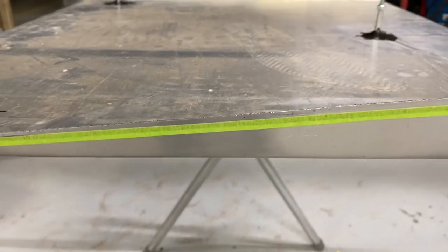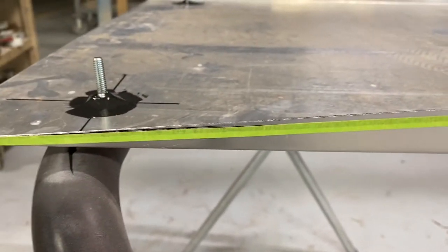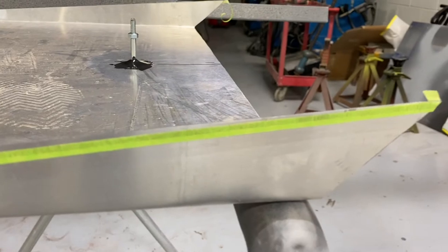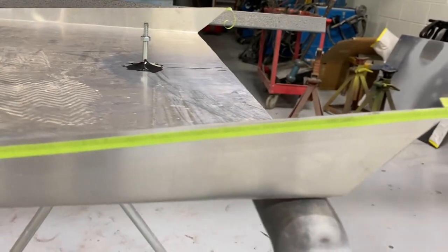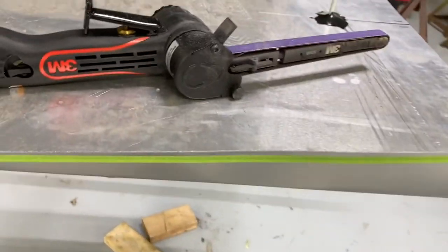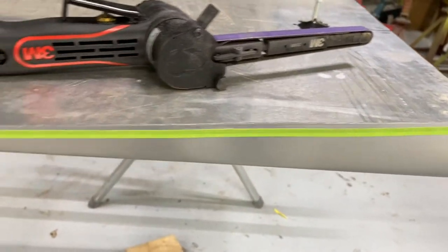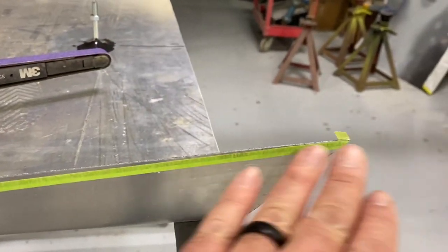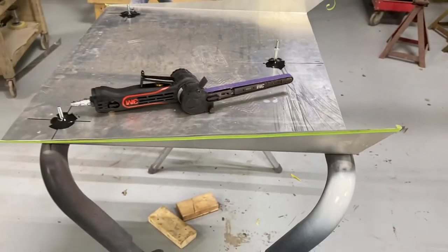What I've done is put a piece of quarter-inch masking tape over top of that line — it gives me a bolder line. I'm gonna use this belt sander to file that rather than try and cut it off. I can take my time and file it. I'm gonna get one side done and then I'll film a little bit of the other side. Hopefully when I'm done it should sit on that hood perfectly.